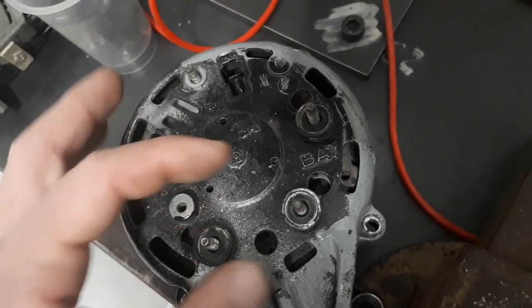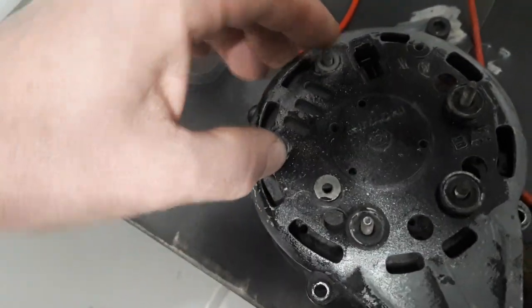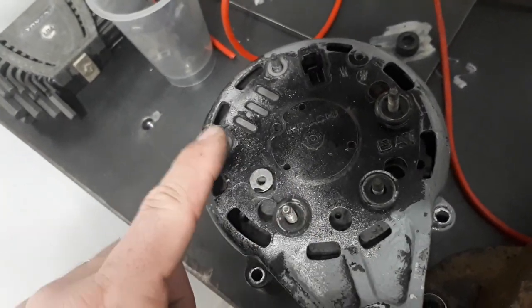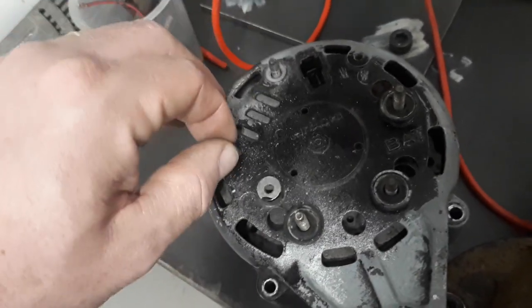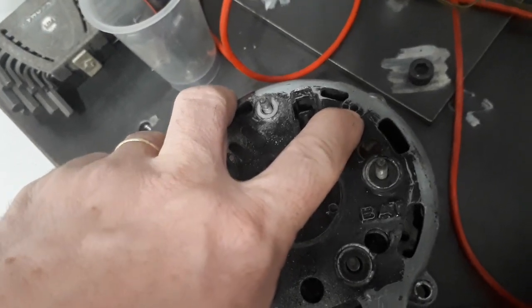Hitachi, which is the manufacturer of the alternator, put insulator bushings here exactly the same as on the positive. The positive needs insulation of course — you don't want it to short on the housing — but the negative for some reason is not connected to the housing. It's funny because the terminals that hold the voltage regulator are actually bonded to the housing, so you need to jump from here to there to get the rectifier receiving current through the negative too. So I'm actually going to need two insulators to install my new terminal.